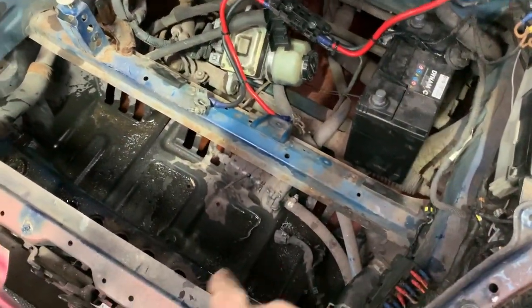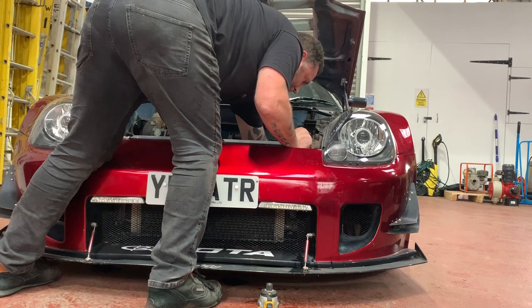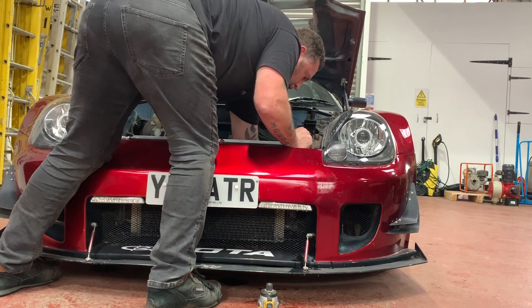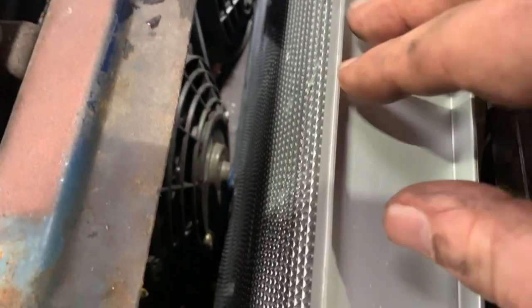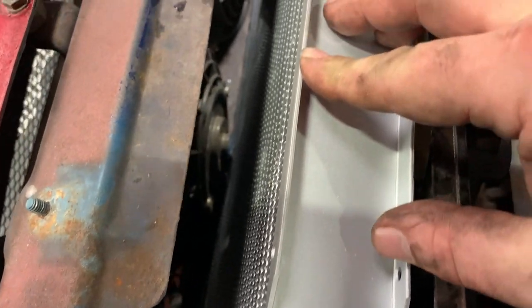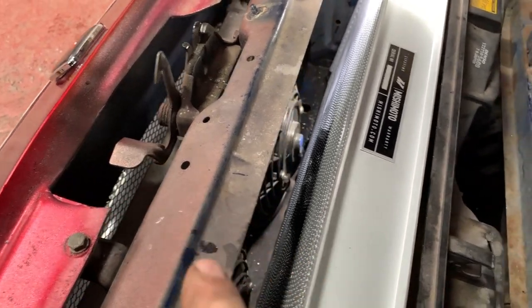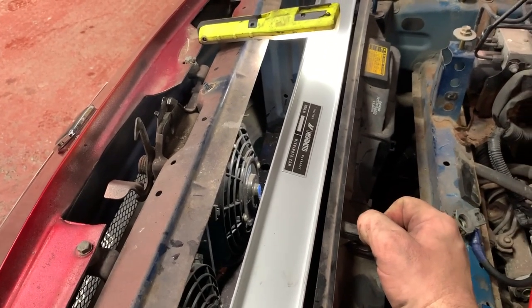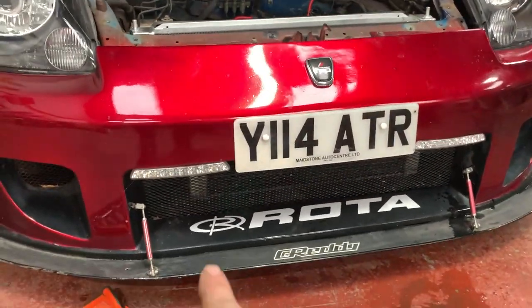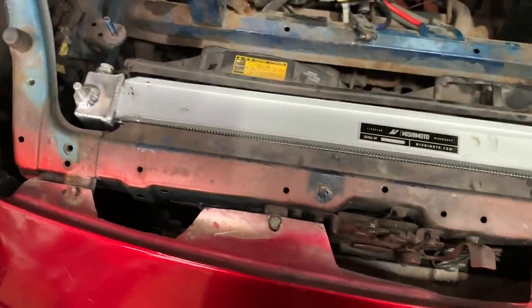It hit a little bit of a snag - because I've got the charge cooler radiator down there and they've got twin fans on the back, it's hitting the radiator. So I've either got to move the charge cooler radiator forward a little bit more, but there's not a lot of gap, or move the bottom of the main radiator out. Turns out it was much easier just to unbolt the bottom of the charge cooler and move that out a little bit. Now it fits in nice - we're not hitting anything behind, everything down there is clear.